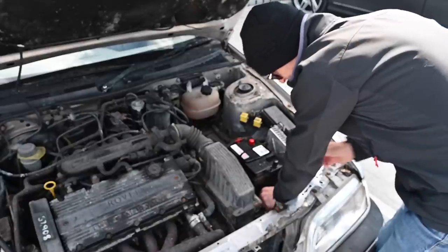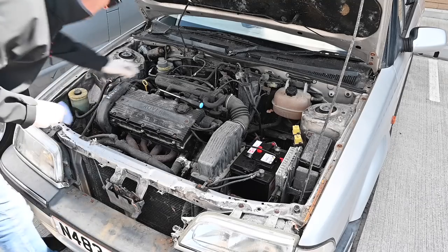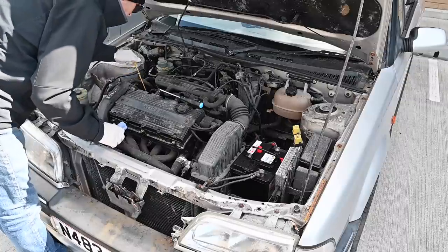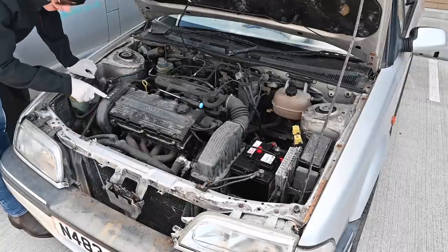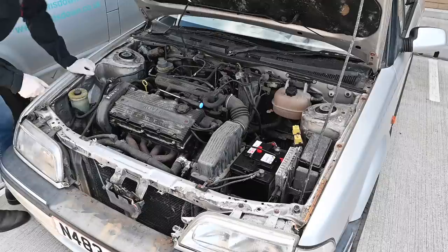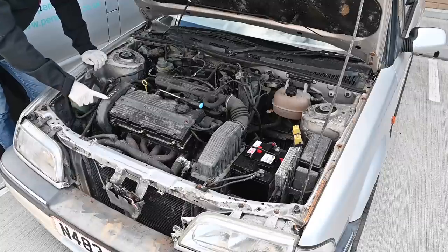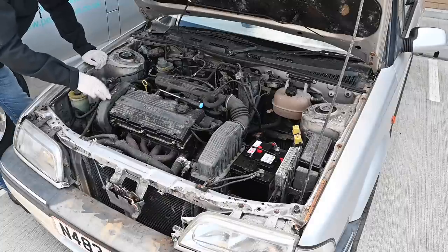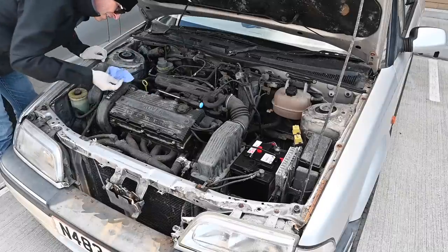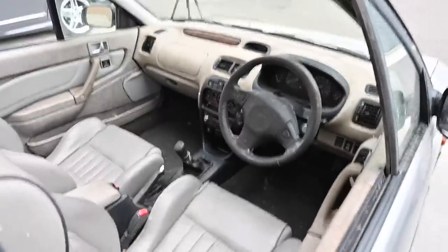I'm not going to do any resto work today, just literally trying stuff to see what happens. Even the courtesy lights are dead. There's a bit of scribble on the timing belt cover which reads 57,908 - call it 58,000 miles - which I think is when the timing belt was last done. It currently has 82,000 miles, so there's only 25,000 miles on this belt, but it's quite old. Apparently the head gasket was done not long before it was parked up, with a head skim as well.